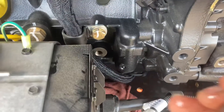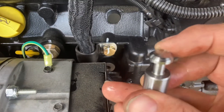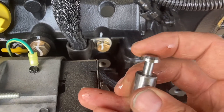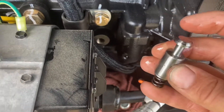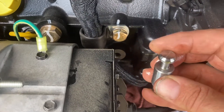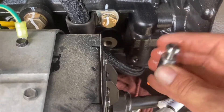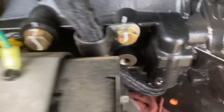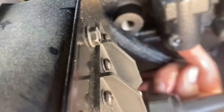On the seat, you might find a little blemish or burr. I'm not seeing anything on this one necessarily, but typically just taking it loose will dislodge what's in there. 99% of the time this will fix that code — just take this out, wash it, clean it, wipe it down. If it's burred, a little polish with 800 grit or a very fine polishing cloth will take off any burr or edge. When you reinstall it, the valve should move nice and free — put your finger on the end of the spring and it should push back out freely. Tuck that back up into place.